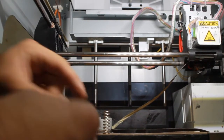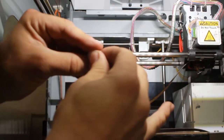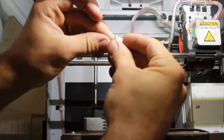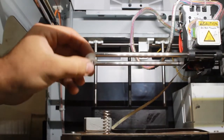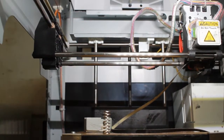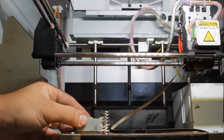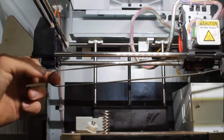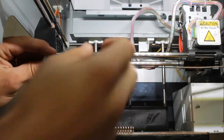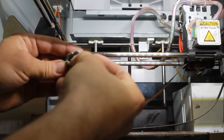There's nothing you have to modify — all you do is take the pulley out. Click the bearings onto the pulley, and make sure you don't lose them because they're so easy to lose. Click the bearings onto the pulley — there you go. This is all original so you don't have to replace anything. Then you 3D print this part. Make sure to line your belt back up, and once you put these bearings on the pulley, put the pulley back on.